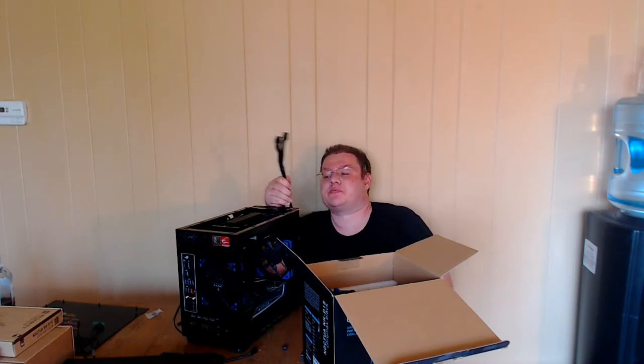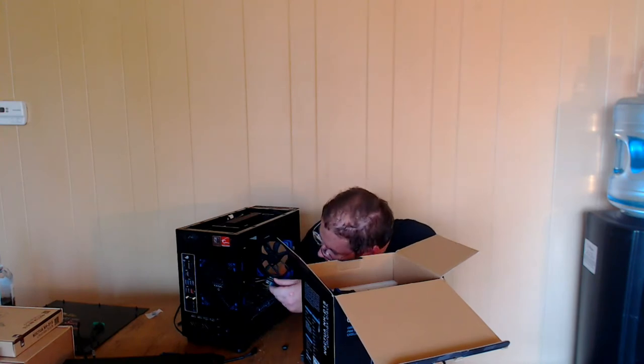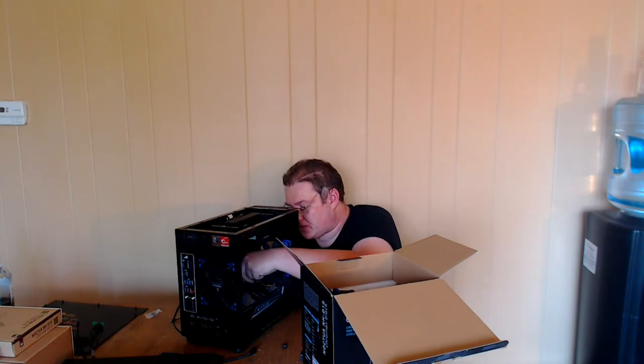This is what you call a challenge, my friend, because we're changing one little thing. I ran the PCI Express card off of one of these, since it has two connectors at the end. And while I'm sure that might work to some extent, I believe you only have 150 watts per connector here, maximum output, and the card pushes out an astounding 240 watts. So, we have to be well aware of where our limitations are and see if that gives any performance increase. Because if it does, kind of a big deal.